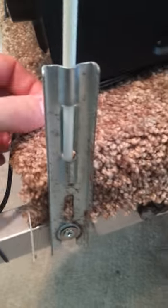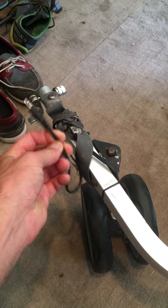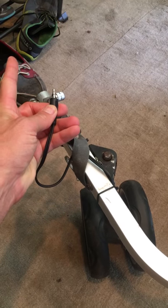This is the home stereo, so it actually goes right over there in the corner. I had a little flag mounted here. This wire coming from the amp I actually just tied right here so that it was next to all the rest of the disconnects. So if this thing does fall off the bike, it will happily just unplug right there and it won't be yanking wires out of amps or anything crazy like that.